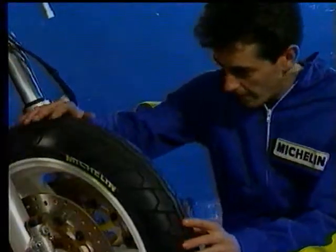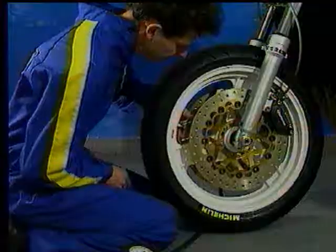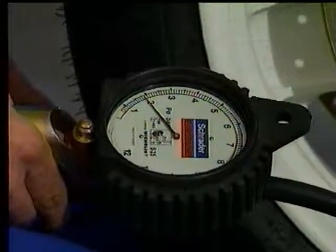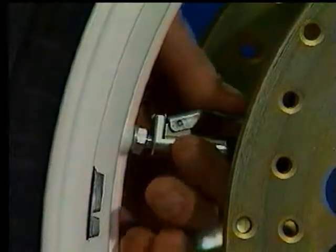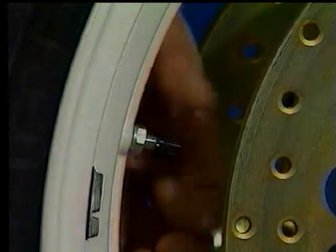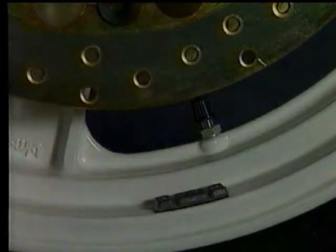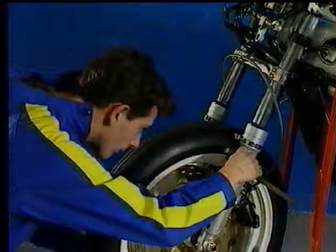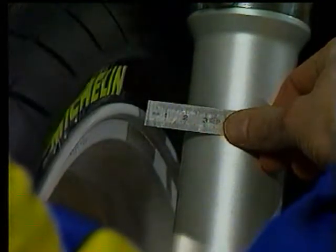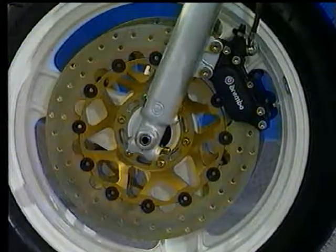Check on each sidewall that the tire has been correctly centered on the rim. Verifying inflation pressure is essential — it must match the values in the Michelin chart. Insufficient pressure at the front can cause transverse deformation of the tire and lead to weave. Before replacing the valve cap, check its condition and don't hesitate to replace it — at high speed, this cap alone ensures the seal. Also verify that balancing is correct. Check that the rim has neither lateral runout nor radial runout by spinning it and using a straightedge resting against a fixed point. Even a slightly buckled front rim could accentuate wobble. A disc brake rotor with a flatness defect can manifest as a particular wear pattern on the tire.